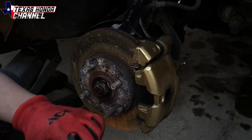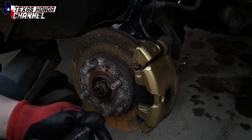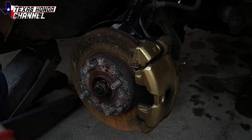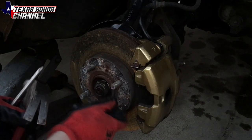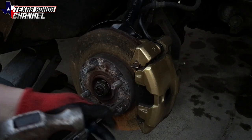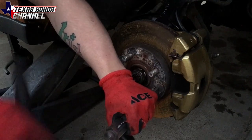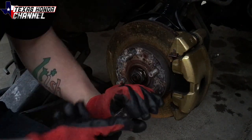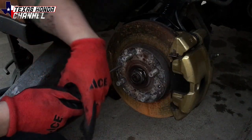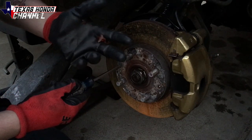On these Civics, typically there are Phillips head screws right here. There are a bunch of different tools they make to get these off — you can just use a normal bit for a screw gun and put a socket on that bit and ratchet it off. Sometimes they don't come out very easy. The method I found that works the best is a hammer and a screwdriver. Basically just do that while turning and it jars them loose pretty well. It doesn't always work, but it does help if you have some penetrating oil or some Blaster or something like that.